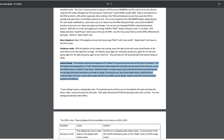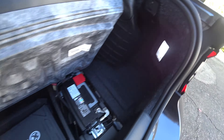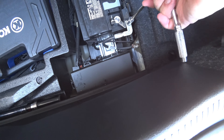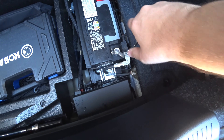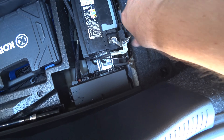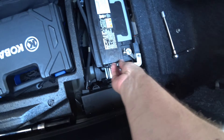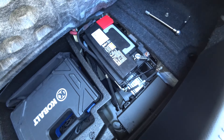With a Tazer module you can remap these aux buttons to other functions. This is a little how-to video to help you out. The first thing you want to do is roll down your windows before you disconnect your battery, then disconnect the negative terminal - it takes a half-inch socket.